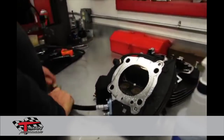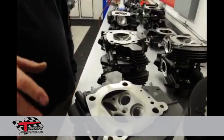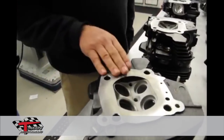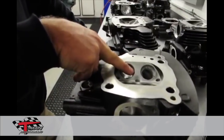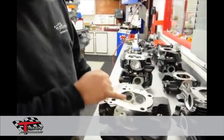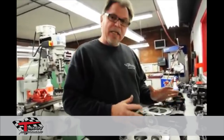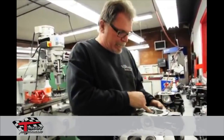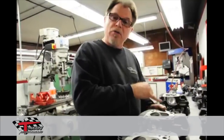After we determined that was the issue, we started to weld the seats out of the heads — that's how we get our heads out. We run a little bead around them and knock them out. What we have determined is that this whole issue is not a machining issue. This issue is coming when the seats are being installed in the head. As you can see right here, this head is one of the worst. You can see the chamfer right here that we identified in our first video. What is happening is when the seats are either pressed in or knocked in — I'm not sure how Harley-Davidson does that — as you start to knock it in, it cocks on that original installation, and it takes that material and scores that bore all the way to the bottom of the seat hole.